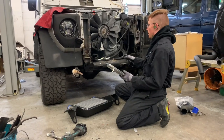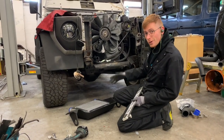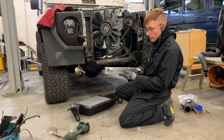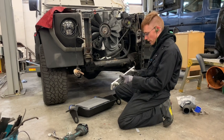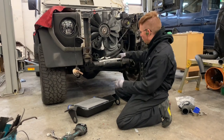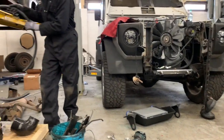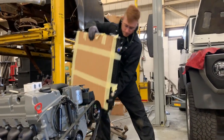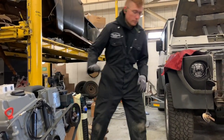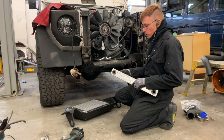On the 460s, when we put these in, the 463 radiator gives much, much better cooling. So we've devised this. This is in raw aluminium, which hopefully the later versions will be anodized. And this basically is a cross member that bolts in place with the original and then allows you to fit the W463 radiator, which is like that, completely different. That gives way better cooling, it's a much better system, but this gives you an option to do it professionally.